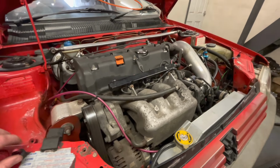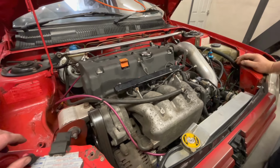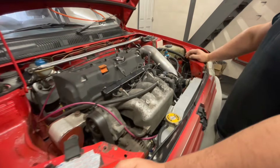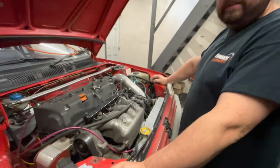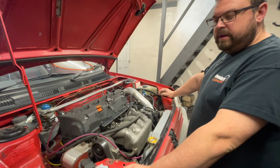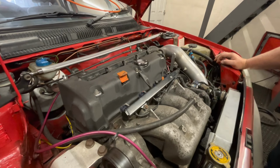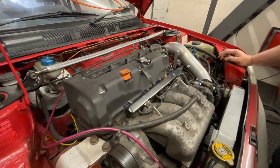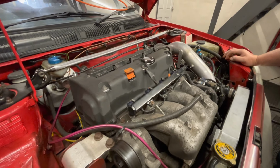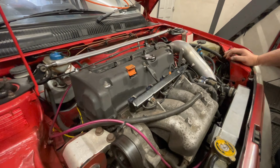And it's done all right, ain't it, Richard? You've enjoyed mapping this one. Yeah, went quick and simple, which is always nice. Now, I noticed that you adjusted the fuel pressure this morning. Yeah, fuel pressure was on 2.5 bar, but obviously you can't be 100% sure whether the gauge is correct. So, we did an initial pull on this car this morning with a good file that we know we've got, and it was running a little bit lean, so we feel that the fuel pressure was down. And the cruise fueling was a little bit lean as well, so we've adjusted the fuel pressure and set that. That's pretty much it as regards to anything we've had to touch. Yeah, it was plain sailing with the mapping, wasn't it? Using the Kpro system, which we've done lots and lots of. Yeah, wicked, man.